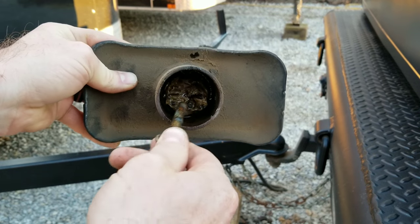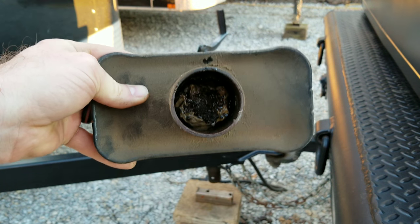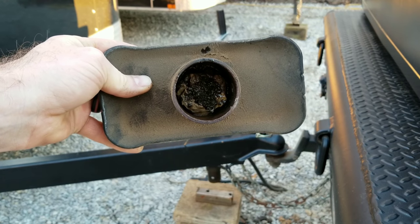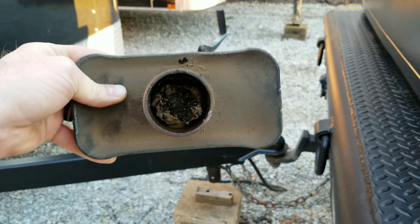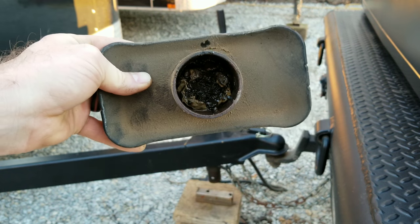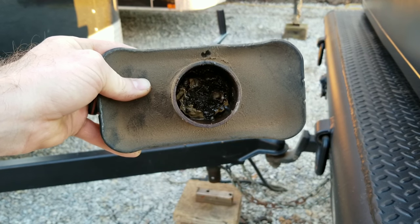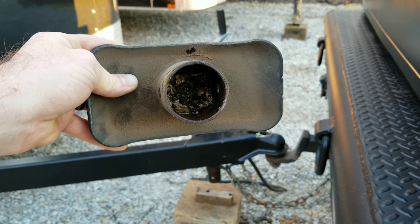or base plate, whatever you want to call it, that's grease. But in that grease, a bunch of metal filings where the gears and the teeth inside the jack are literally deteriorating. I knew it felt pretty rough. Kind of like a grinding feeling going up and down. Didn't realize why, other than that it was about wore out.